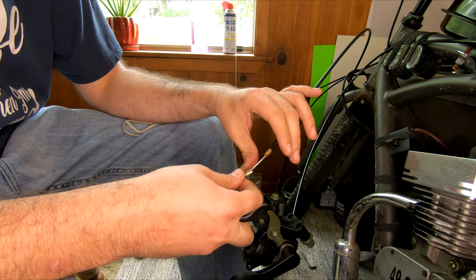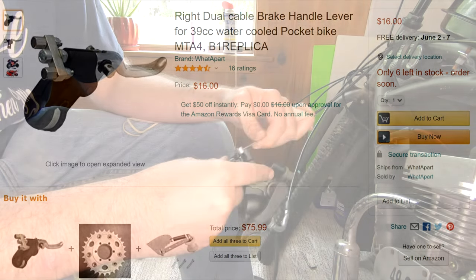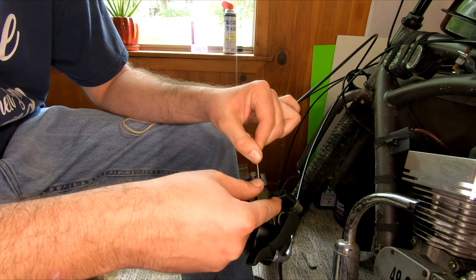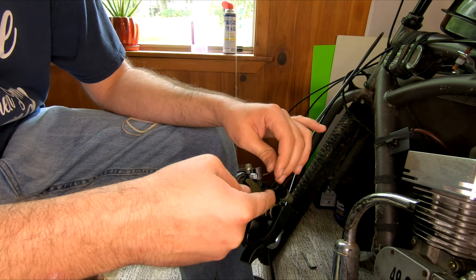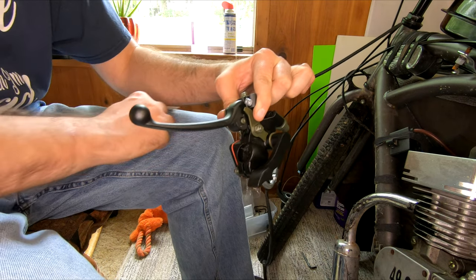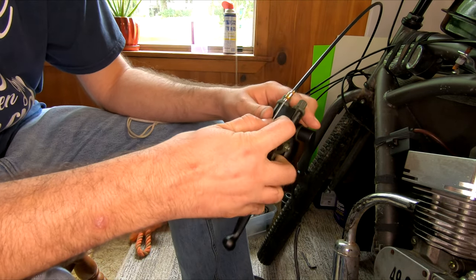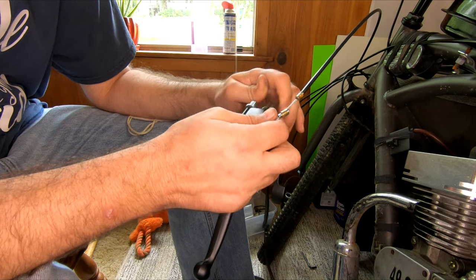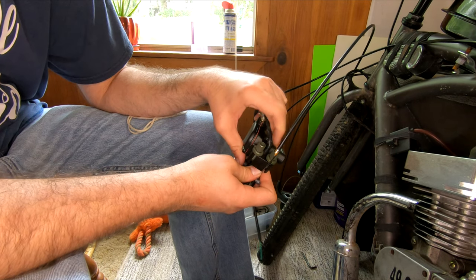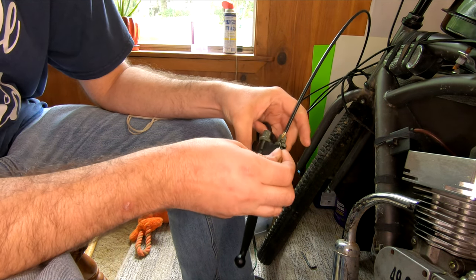It's better to understand that both tires are getting even brake pressure and ride accordingly. There are levers that allow you to fine-tune adjustment to apply pressure to one tire before the other, but you really need to know what you're doing. In order to make this work on some builds, you'll have to modify the cable sleeves to make them fit, as well as round out the nubs on the end of the cable so they'll fit inside the cradle. Please be sure when grinding down the nubs you're using a face mask - this is metal and you don't want to be breathing it. Luckily, the Kent Bayside has an outer sleeve that fits over the cable, which makes them fit quite nicely. On my original build, the Basset Blaster, the cable sleeves were real loose, so I had to add spacing using electrical tape and heat shrink.